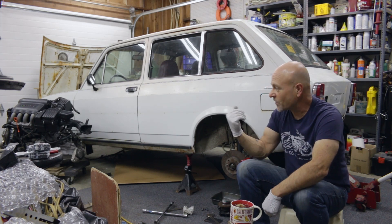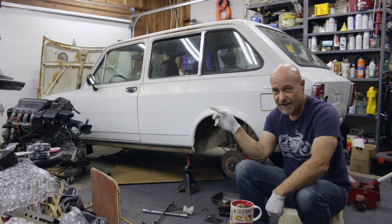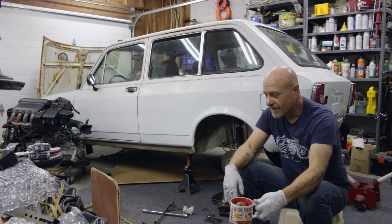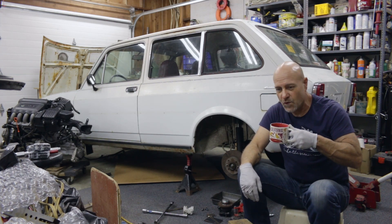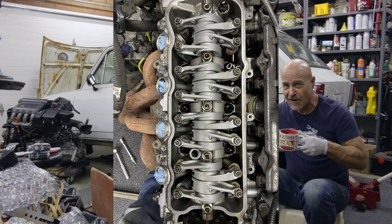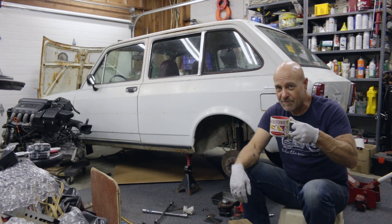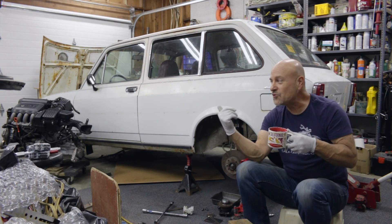It's just a joy. When I popped off the valve cover — and I've popped off valve covers on who knows how many engines, cars, motorcycles, everything — most of the time especially with something that has 200,000 miles on it you expect a burnt oil residue on everything. But this thing looks brand new inside. I've seen other videos where guys are adjusting valves on their Honda Fits and they're similarly clean. Hats off to Honda — adjusting these valves was so simple, and it's really hard to screw it up if you just take your time.